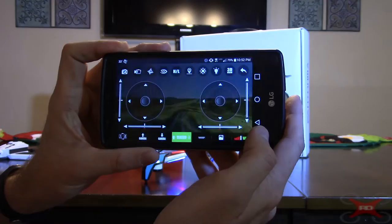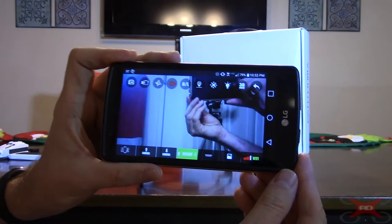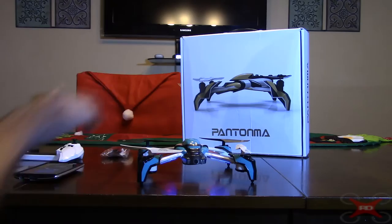Once connected, go to the app, back out and start it up again, and it should bring up the live feed. You can see there's a bit of lag to it, which you expect with Wi-Fi FPV. The farther away it gets the lag gets worse — during my flight review I got into my neighbor's yard and the lag was making it difficult to see which way I was facing, because I'd correct and the feed would be behind. That's pretty typical with Wi-Fi FPV flyers.